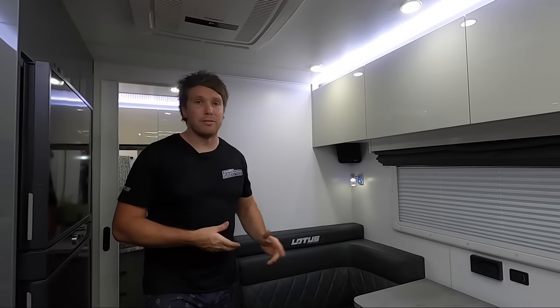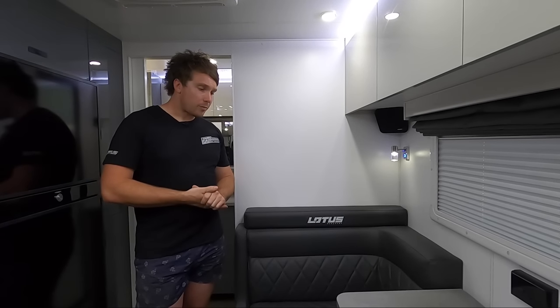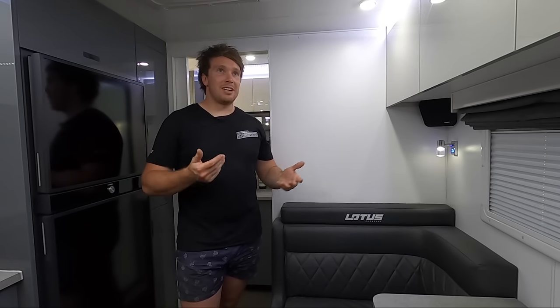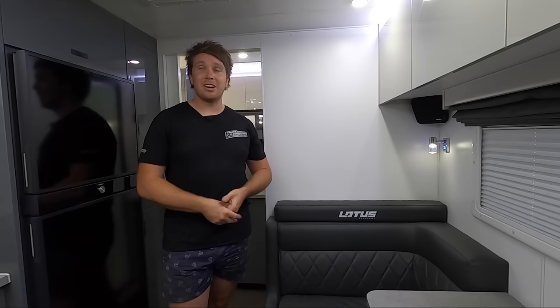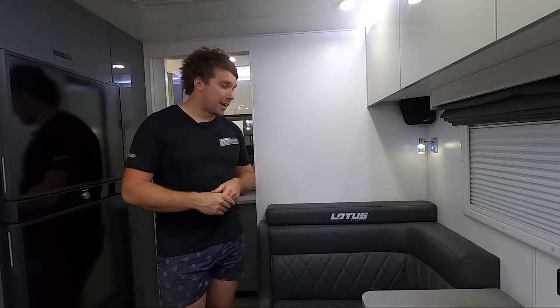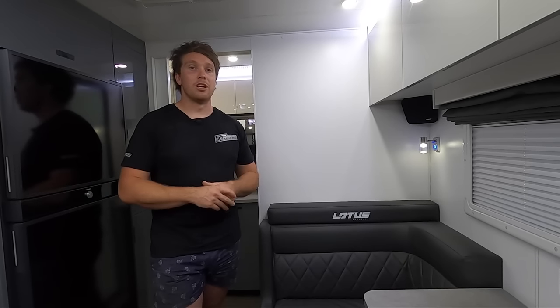While we're here, let's get into the battery system. We've actually got this running off the inverter at the moment. The batteries have been going — we've got 300 amps of lithium batteries, using the Revolution batteries, and a 3000 watt Redarc inverter. We've been here for probably nearly three hours and it's sitting on about 70% battery. We're in the sun though so it is getting solar. Last week we tried it in the shade — had it going for four and a half hours, running the air con with lights and all that, and had about 30% left. So you'd get about four to six hours running the air con off the inverter, which is more than enough.